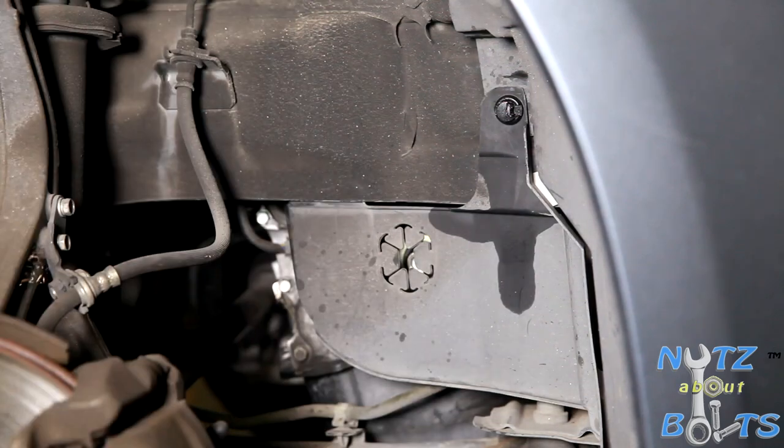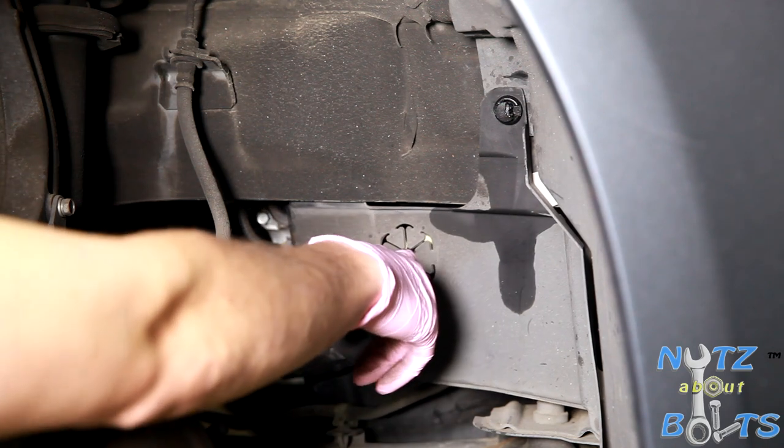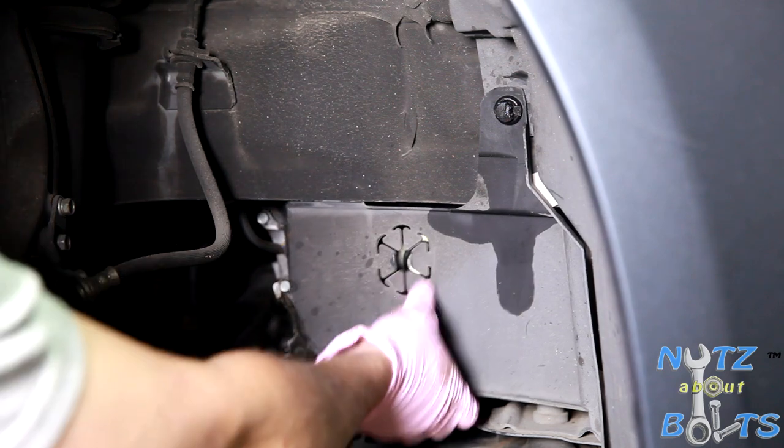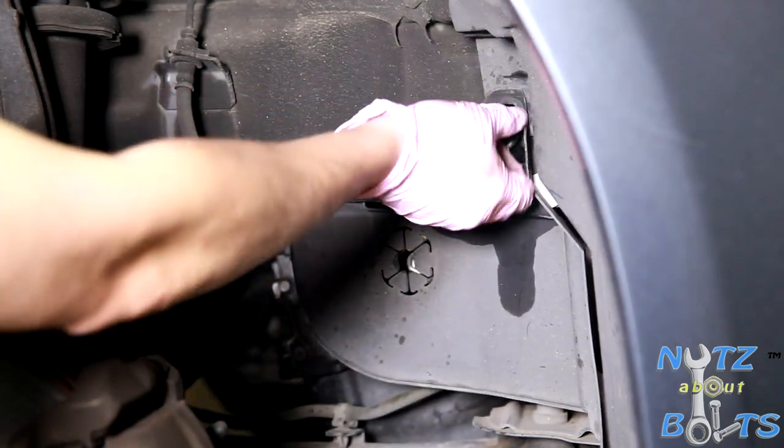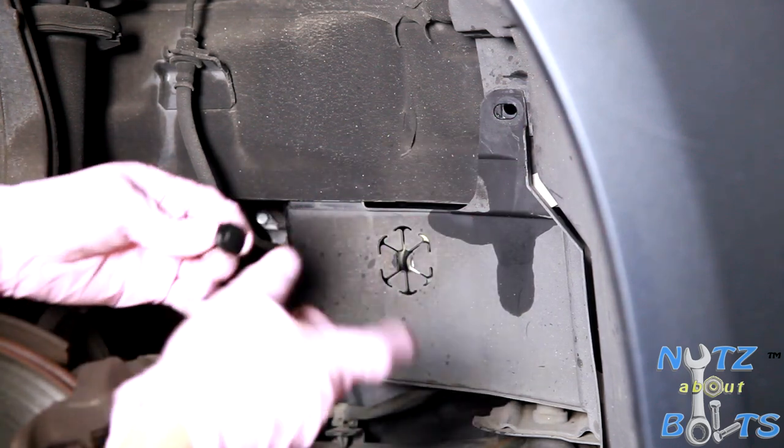All right, so as part of the valve adjustment, this is definitely necessary. You need to rotate the engine to where the pistons are each at their top dead center. And in order to do that, you need to rotate the motor manually. To gain access, there's the crankshaft bolt in there, which I guess you could access through this opening, but it's nicer just to take out the clips. And you can just pry these clips out.